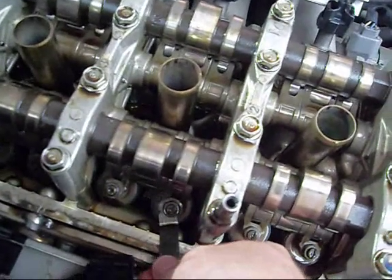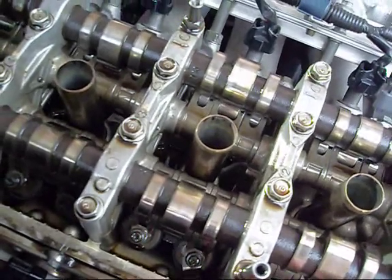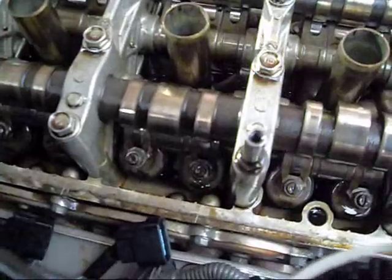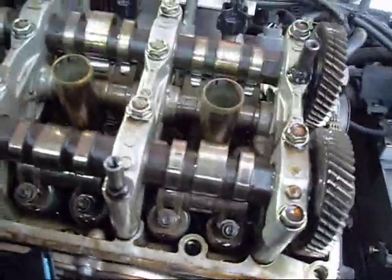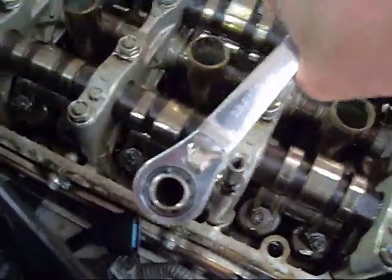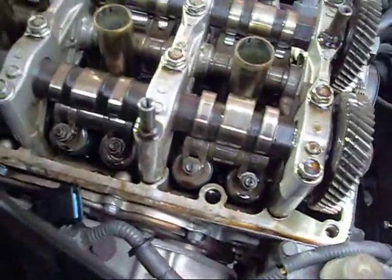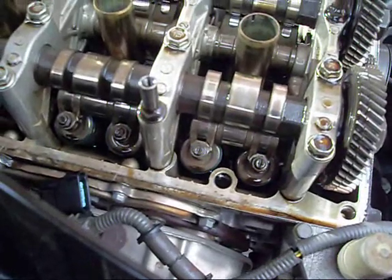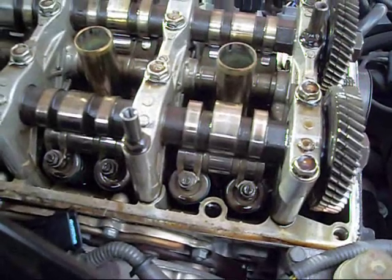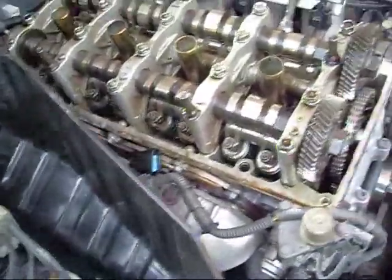Using my 9 thousandths gauge — I can get this in. There we go, in and out. There's a smooth feeling — you can feel the friction on it, but it's nowhere near enough to overcome the movement of the feeler gauge, and that feels nice. Make sure I've torqued it up — that's not going anywhere. I've got one less valve to do, but it'll be exactly the same procedure. After that, check all your torque settings, make sure you go around all of them, confirm they're all torqued down nicely, and then you can reassemble.